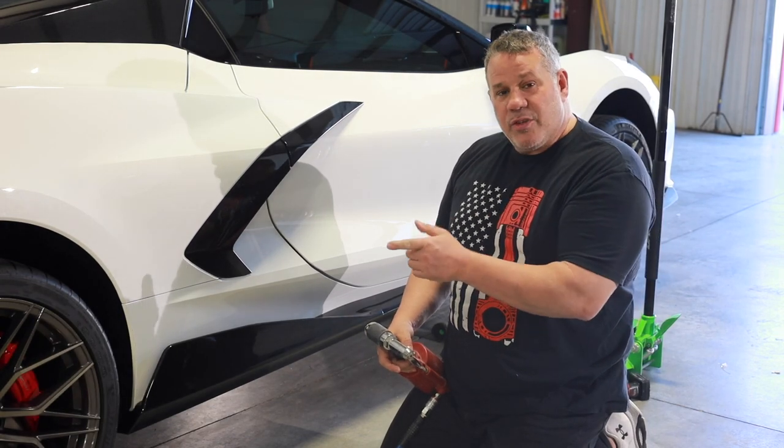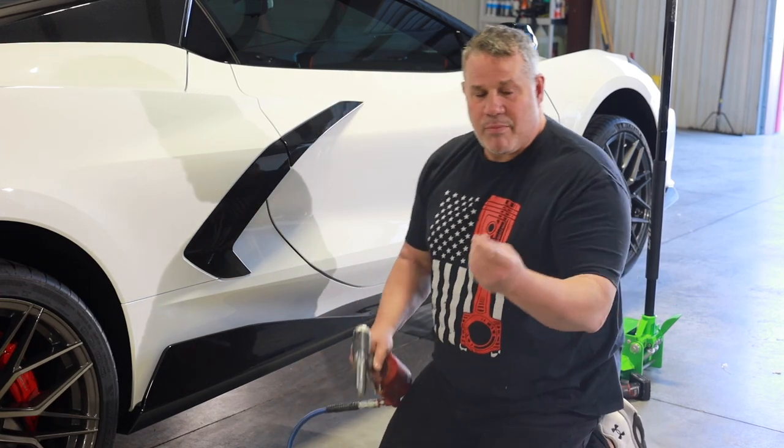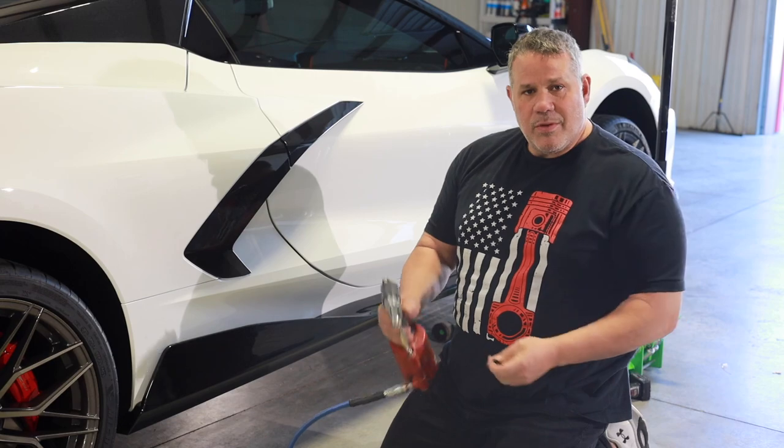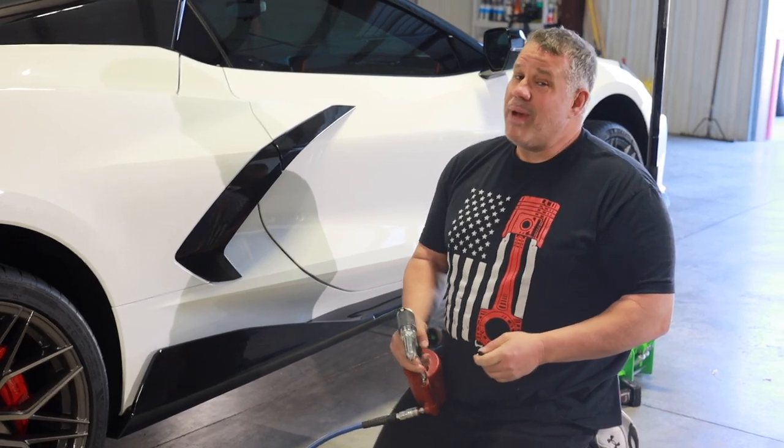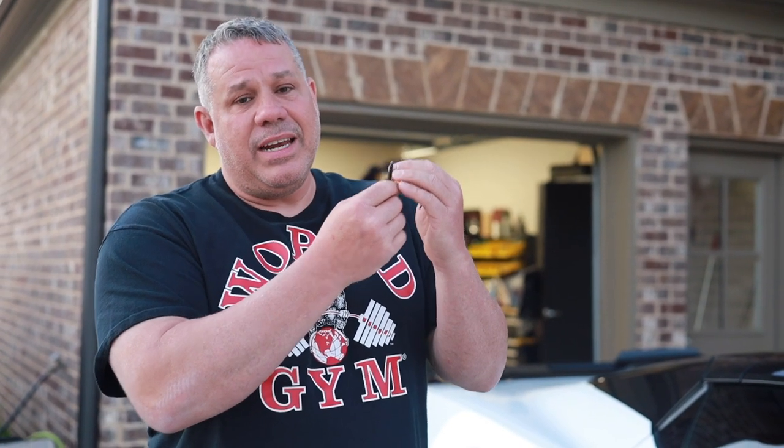As you can see, we had to drill about a dozen holes down the side of this thing and they give you nice little pop rivets. CEO Joe was nice enough to give me a pneumatic pop rivet gun. Be careful because there are two different size pop rivets — a short one and a longer one. The longer ones go towards the outside of the car, the short ones go towards the inside because when you drill, the frame will be real close. Stick the pop rivet in there and tighten it up. Remember: the larger pop rivets go on the outside when installing these skirts.